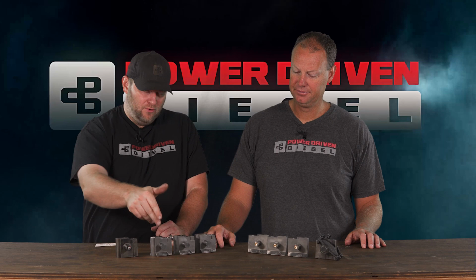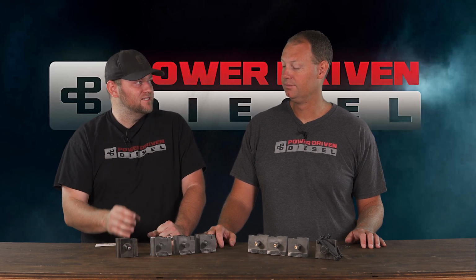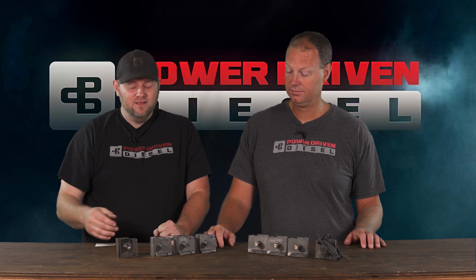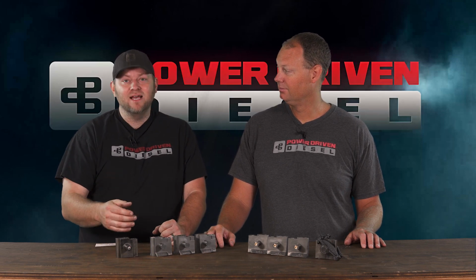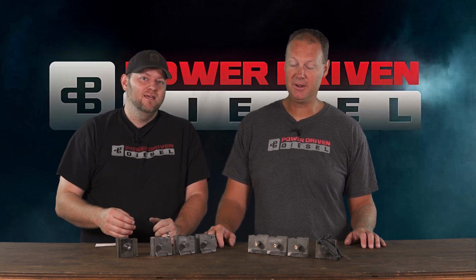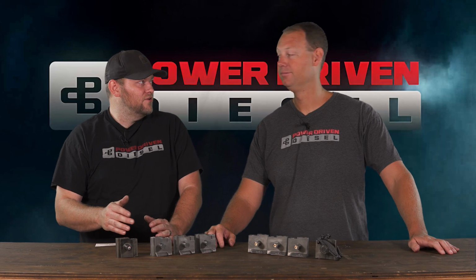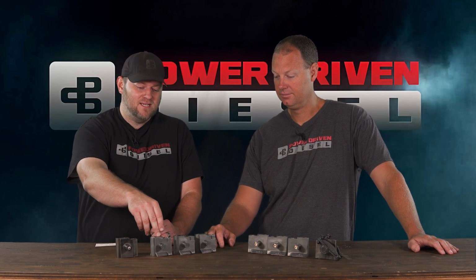So we ended up going to a 17-4 aircraft quality stainless alloy. I've got to read my notes here. This was homogenized and solution annealed in a vacuum oven. It's a fancy way of saying it was heat treated. Heat treated to about a 32 to 35 RC is where it's coming in. That puts it at about 150,000 PSI tensile strength.